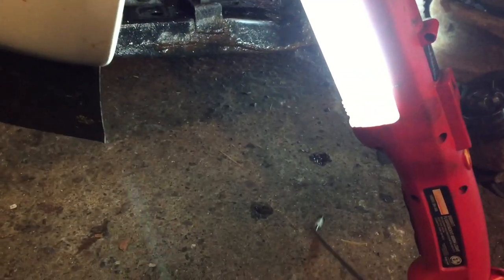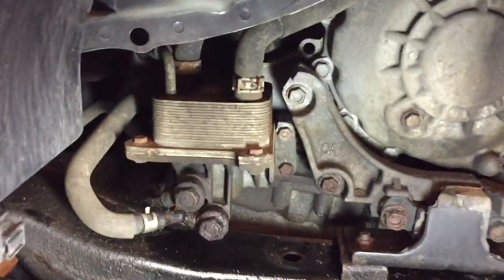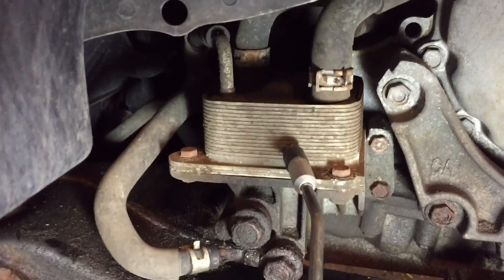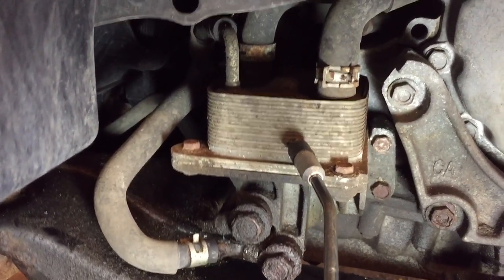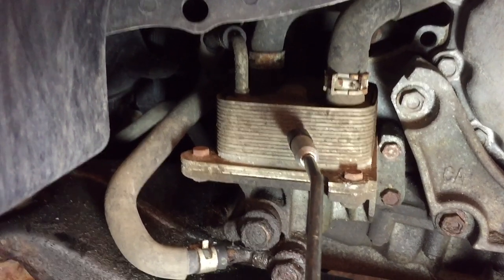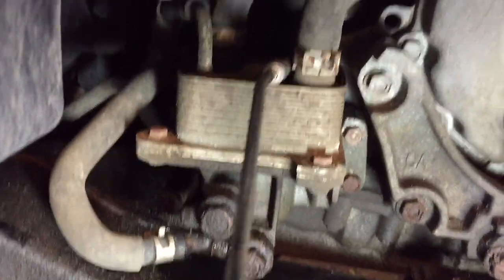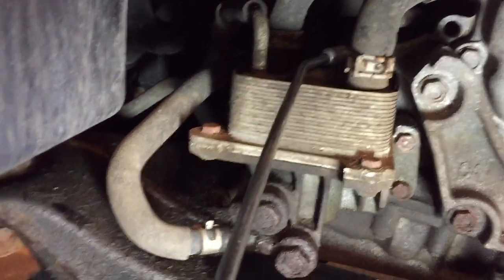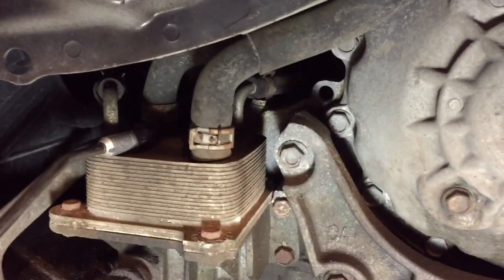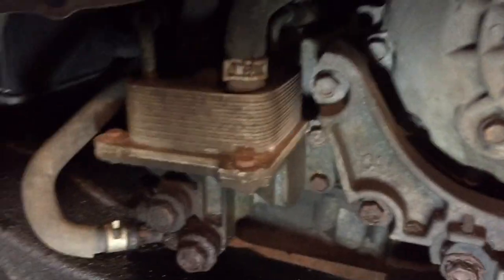I had to add about one and a half quarts of CVT fluid. Because of where the drip was coming from — all the way back here — I learned a long time ago that if you have a drip that far back, it probably comes from further forward and up, because of wind and how the car drives. So I came over here and I can see this is the cooler for the CVT fluid — this is called an oil-to-water cooler. The car actually pumps coolant through one pair of these tubes; there's another one back in the corner — there are four tubes total.